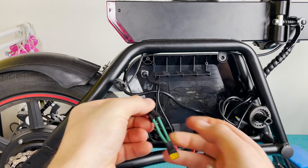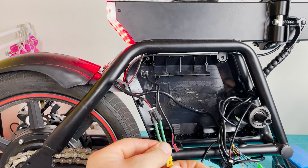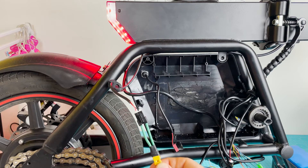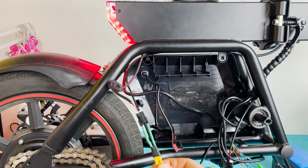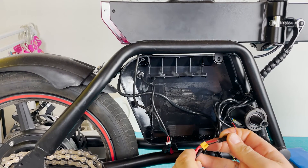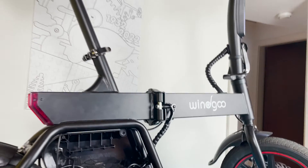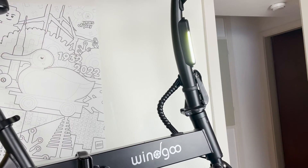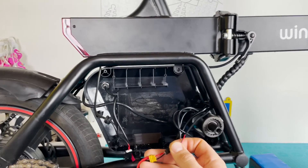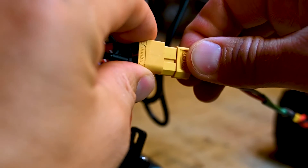Some very sophisticated testing to figure out if the tail light can survive at 48 volts. It works! I don't know how long it will work, but it does. We also tested the headlight in a very similar way — and it works as well. So I think we can simply use 48 volts for the lights.